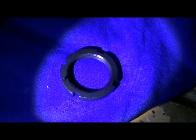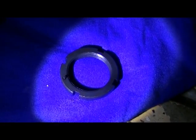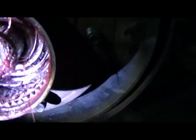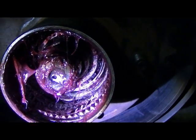Alright, so you're going to put it on. It's a castle nut, so you're going to have a castle socket, castle nut socket. When I ordered my Mile Marker kit, I ordered it with it. I ordered it from Amazon. Came with everything. Actually, I think it came from Mile Marker. They were just selling it on Amazon. So you're going to put this nut on first. It's going to rest up in there, pin facing you against the bearing. Pretty much a no-brainer.